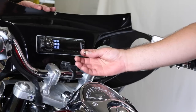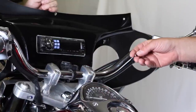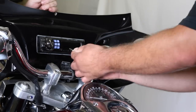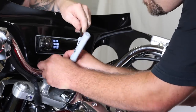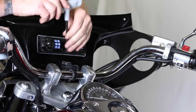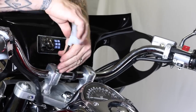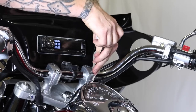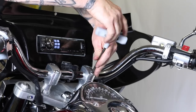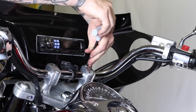We're going to rock the handlebars down out of the way because we need to drill through to mount the speakers. These bolts have little chrome decorative covers that pop down into the Allen — so you just take a little screwdriver and pop that bad boy up out of the way. Get all four of those out of the way, then take the six-millimeter Allen wrench and loosen up all four of those bolts. You don't need to take them out, just loosen them up.